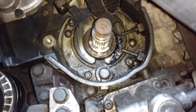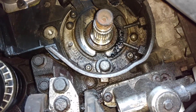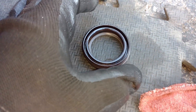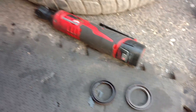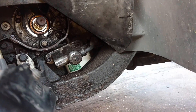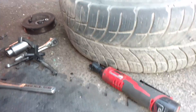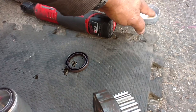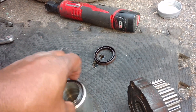And that's the seal I need to get out. Let me work on getting that seal out, clean that up, and put this stuff back together. I'm going to go ahead and put my tool on it and get it installed. There's my tool. I'm going to put some oil on that — oil on the seal. Put the seal on there; I'm going to probably use the bolt to set the seal all the way in. That's the seal over the tool. Put a little more oil around this edge here, just to make sure it's all cleaned out.